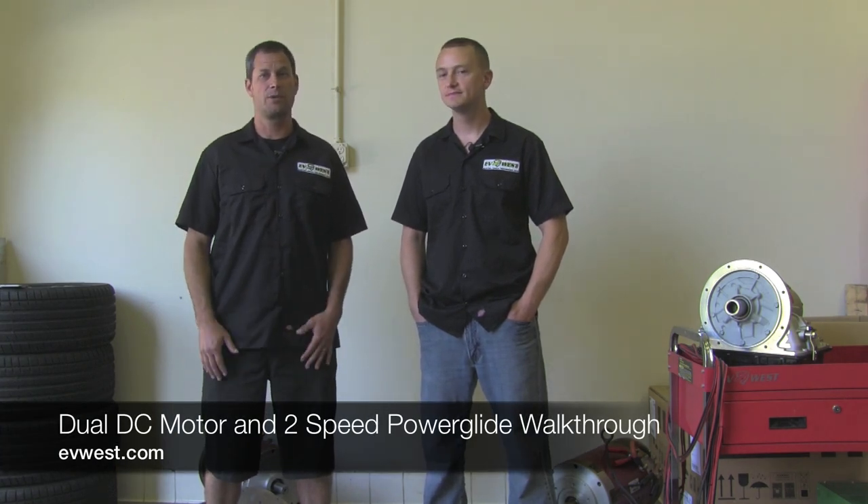Hi, I'm Michael Breen with EV West. And I'm Matt Haber. Today we're going to talk a little bit about the drivetrain in our BMW M3. We get a lot of inquiries about this car ever since we set a record last year for the street-legal electric class at Pikes Peak. It's the same car that's in the famous video with Bill Caswell, the big old EV grin. A lot of people wonder what's involved in making a system like this. It's pretty simple — two NetGain 11-inch motors hooked up to a PowerGlide 2-speed transmission without a torque converter. It's a direct drive system. Matt's going to show you how to put the motors together, couple them, and then hook them up to the PowerGlide transmission. Hopefully you can put one of these in your own project. Let's get started.